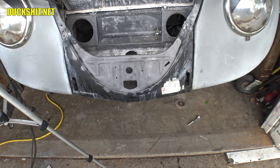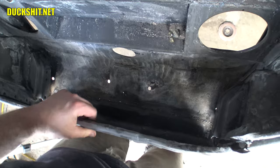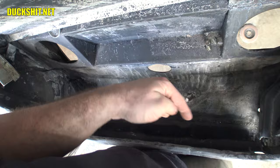All right, I think this is the first time that it's had a floor in the trunk since I first got the car. When I got it, there wasn't a trunk in here at all. Yeah, this is gonna work out okay. Push the apron onto where it needs to be. I can spot it into place. And then I can push down on the floor, clamp the two together, and then spot along the edge here and get that wrapped up.